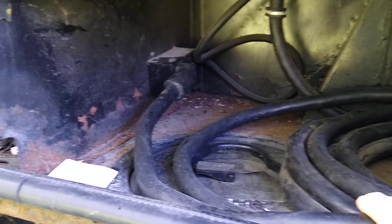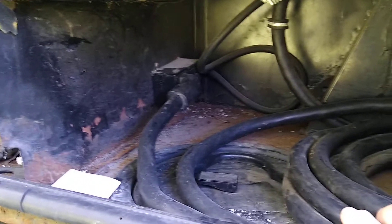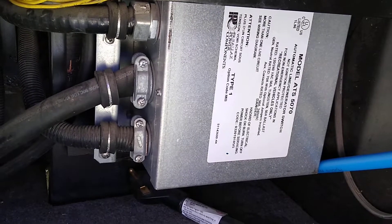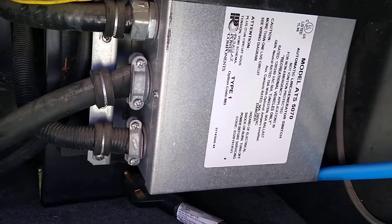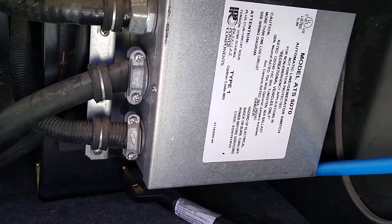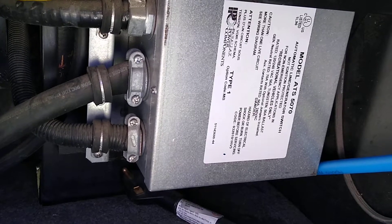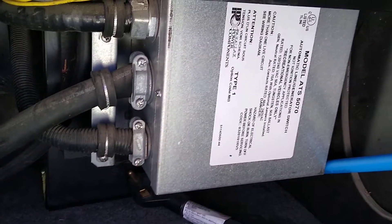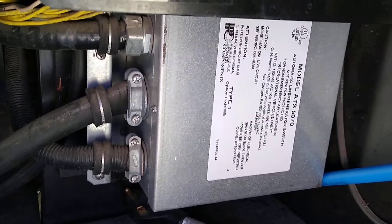What about your generator? With our onboard generator, I believe this is true with all RVs that have a manufacturer-installed generator — it also has a built-in transfer switch. So when you turn on your generator and it comes up to voltage, that transfer switch automatically disconnects the shore power cable, which disconnects it from your inverter. Just to be safe, I always turn off the circuit breaker, but if I forget, this transfer switch is the failsafe — it prevents any power from back-feeding into our inverter.